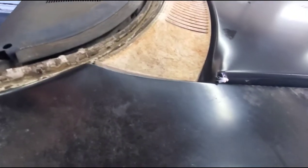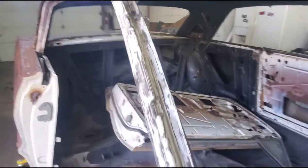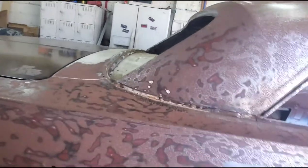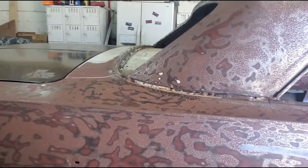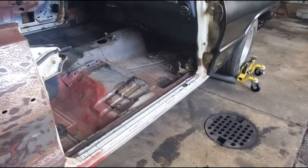There's still a fair amount of rust and rot in different places. This is the upper front windshield area — the rain gutter on this side looks pretty good, but it looks like they started stripping the car and then left it outside to rot. We're going to have to sand this down and at least get epoxy primer on it. The quarter panel is cracked, so we'll have to weld that up.